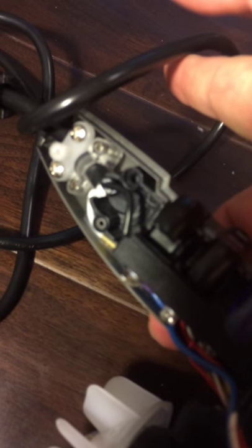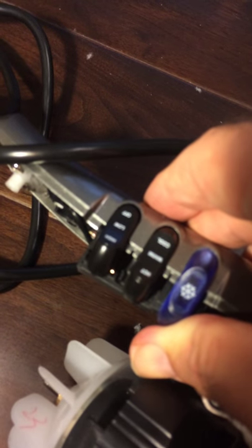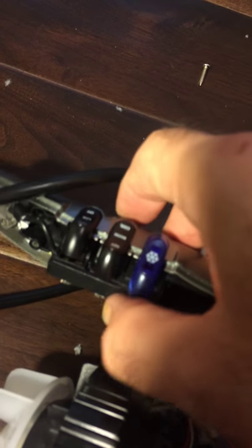So let's take a look at the innards here. I'm not an EE or an expert, but I've torn things apart. These switches are well done - they're installed as a slip-in assembly into the plastic. Here we can see how the power cord is entering the unit. It goes right to the main switch, which has an off, low, and high setting. The mains are cut off when you go to off, which is handy.